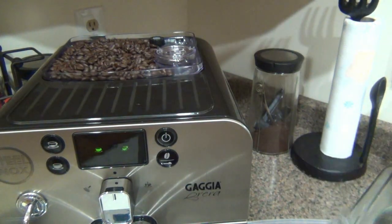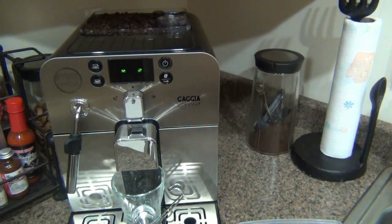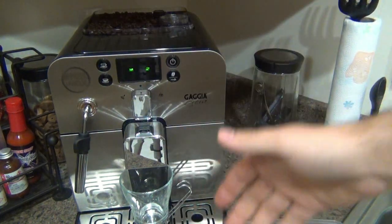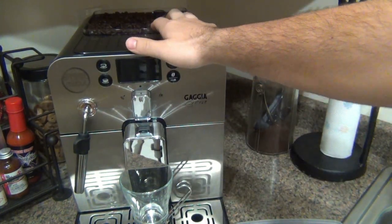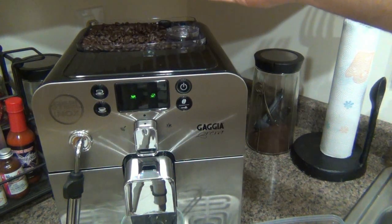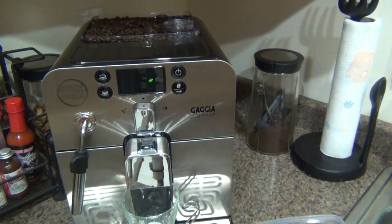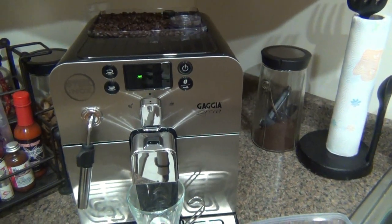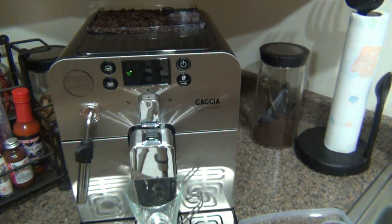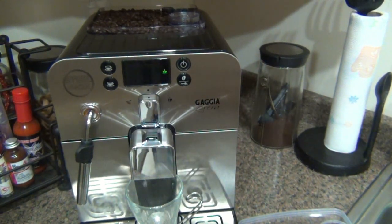Super automatics have their own built-in grinder — that's what makes it bean to cup, doing everything for you. There's a coffee grinder within the machine itself. When it goes on, it vibrates and pulls beans down and grinds exactly what you need for one brewing process. Every single time you brew, it grinds fresh coffee beans. Right now it's doing a pre-brew wash, pushing hot water through the system to clean everything out — you don't want old residual coffee in your new cup.